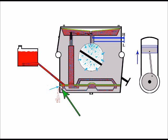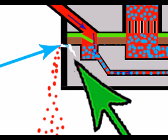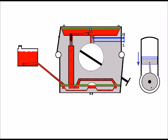This same effect, incidentally, can be brought about by a cap that's damaged. So even if it's nice and tight, and the screw's nice and tight holding it there, if there's damage to the side of the cap, it can draw in air similarly and cause the same sorts of problems.